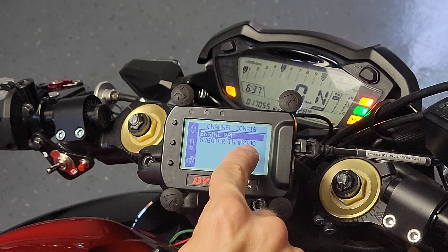The bike is idling just under 2,000 RPM — giving it throttle now and the light triggers perfectly. I'm really happy with the end result. I go to the drag strip mostly at night, so a bright external LED will be very helpful. The soldering portion required patience and troubleshooting, but once you know what's happening you figure out exactly what to do. If you'd like to see a more traditional shift light installation for this bike in the future, let me know.